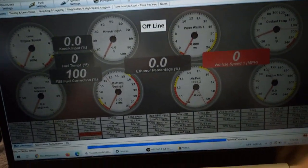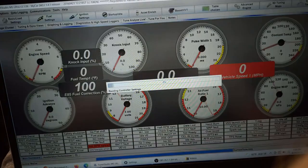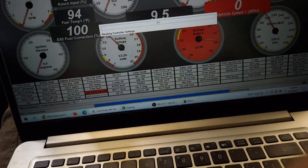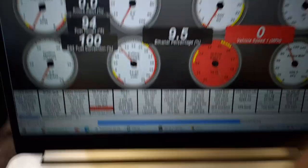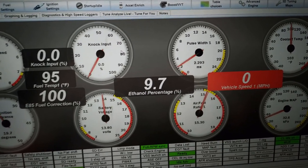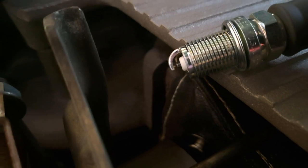In the car now, switching to the cam view. Turn to the first key position so the ECU turns on — it'll tell me settings have changed. Review and send. Next step is to do the test. After warm-up, all settings and temps are the same as before. Once I get it up to 2,500 RPM and stay there for a minute or so, the AFR stays steady at 13.3. Just for fun, let's compare the spark from the Toyota COPs to the Max Sparks.